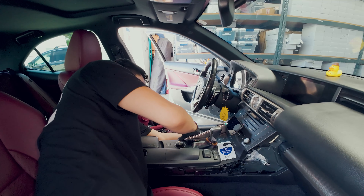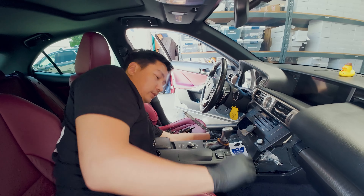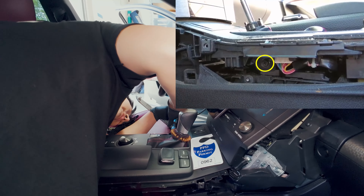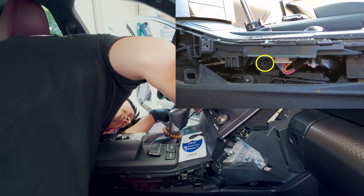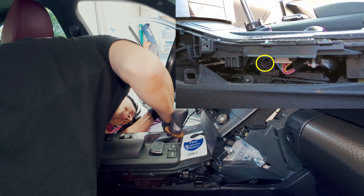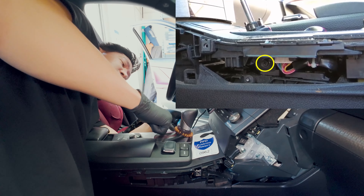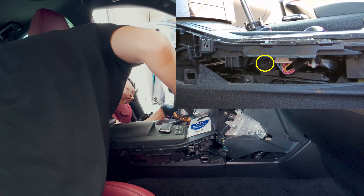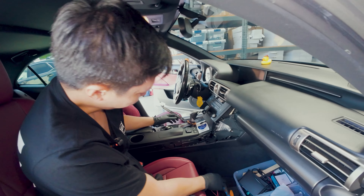Just place your hand on the inside and pull it out. There's one 10-millimeter screw here. You can refer to the other video if you want to know exactly where it is, but basically where the shift knob is — between the parking and the reverse, right under there — you'll find another Phillips screw that you need to remove.